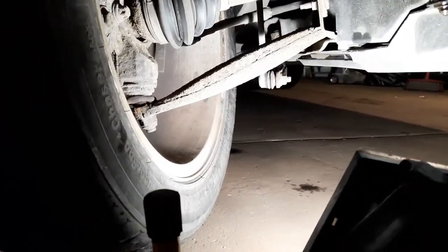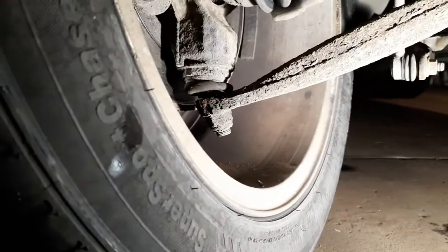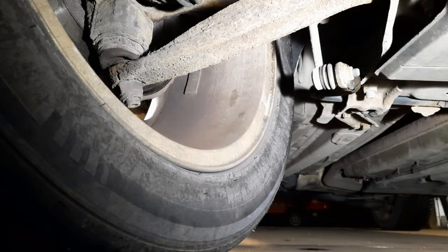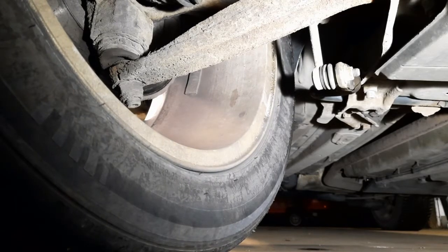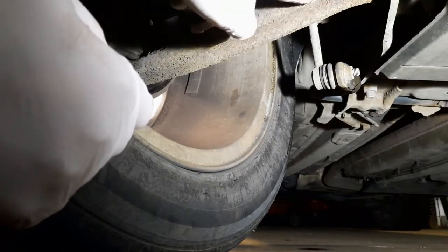I've jacked it up so the wheel's off the deck. At first I couldn't see anything obvious — a common MOT failure would be if the rubber boot had split, but it looks okay, just a tiny nick in it. However, when you wobble the wheel, if you watch that bolt at the top you'll see the amount of play that's in there. You can actually feel it and hear it as well. That ball joint is definitely bad, and the other end of this wishbone has got an advisory for the bush.